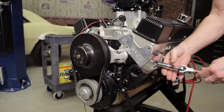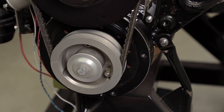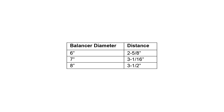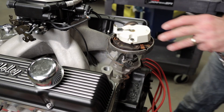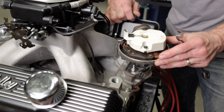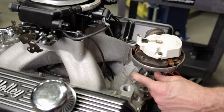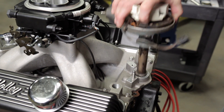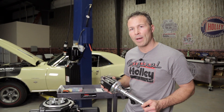Although it's not required, removing the spark plugs from the cylinder heads will make it easier to rotate your engine. If your harmonic balancer isn't marked all the way up to 50 degrees, you can use a tape measure to measure the diameter of your balancer and determine whether it's a 6, 7, or 8 inch. Use the chart included in the instructions — from the zero mark, measure the appropriate distance and make a mark on your harmonic balancer. Disconnect any remaining wiring or vacuum hoses still attached to the distributor. Loosen and remove the distributor hold down, and once that is complete your distributor should lift out. Check that the new distributor seats fully and doesn't bind or bottom out on the oil pump drive.